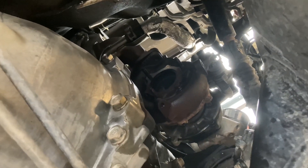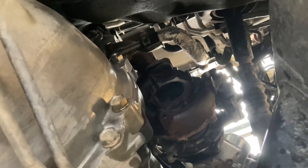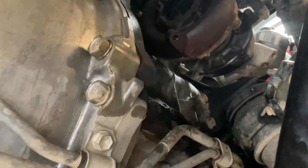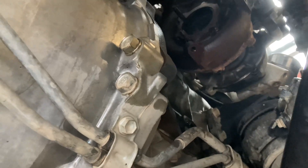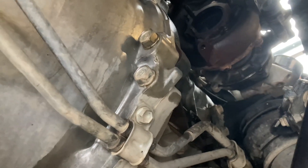There's more info in the other videos, but I'll give you what I can. One of the hard parts is you've got to get the dump pipe off the back of the turbo — those three bolts, they can be rusty, they can be a pain. Either way, they're going to be tight. You've got the bracket on the bottom of the turbo, a few bolts going on there. They're going to be hard — it's just how hard.